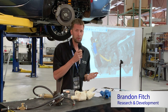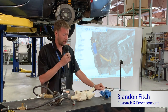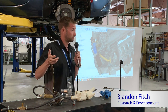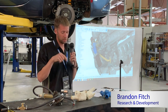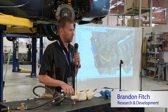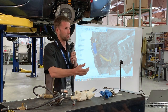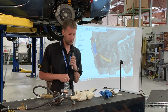We wanted to make sure there were different temperature options available for the thermostat, and we wanted to make sure that all of the sensors had to work. So the ECU sensor has its own ground, so no worries, you can put it in a plastic, fine, no big deal. The gauge sensor grounds through the housing that it's in and through the engine. So if the sensor is electrically insulated from the engine, it's not going to work, or it's going to work really inconsistently. So that was another one of our design parameters to make it work.